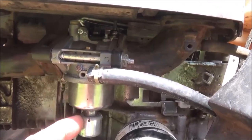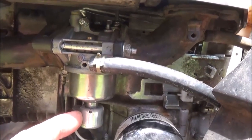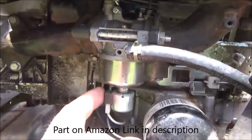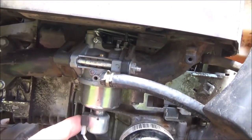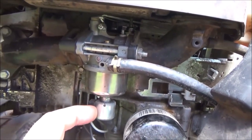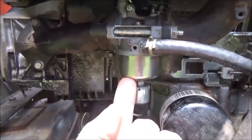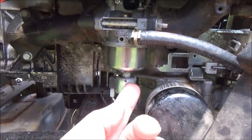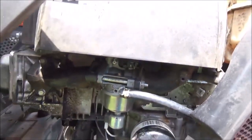It's hard to find this particular one for this mower, because it has a little seat on the end of the pin. Other ones have just a pin that goes straight up with a point, and some even have a little flat piece on the bottom, but this one has a little seat. I couldn't find one for less than forty to a hundred dollars. I could get it from China for eight or nine dollars, but I didn't want to wait a month to a month and a half. So I did some research and found out that you can cut that little pin off and it will let the gas through — and after I cut it off, it worked fine, cranked right up immediately.